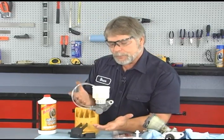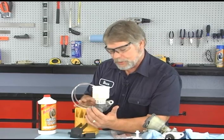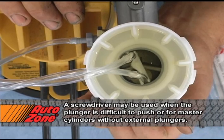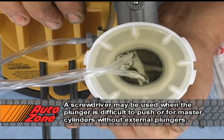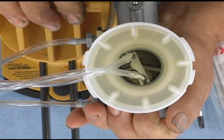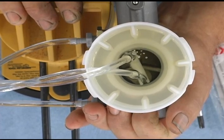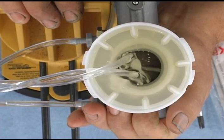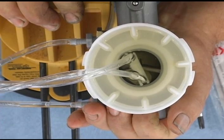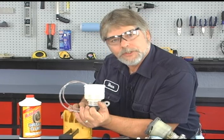We've got it basically ready to go now. The procedure is very simple. This one has the plunger that's external. What I want to do is press the plunger all the way in. First we're going to see bubbles coming up through the reservoir — there's no fluid at all in the hoses yet. Now let off the plunger and you're going to see the fluid start coming into the ports. You want to push it all the way in, hold it for just a second, then let it off, and basically just repeat this process until there are no air bubbles visible.